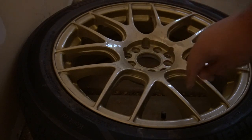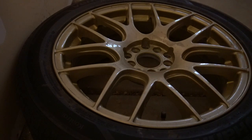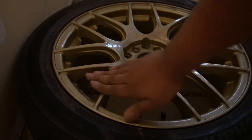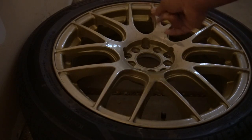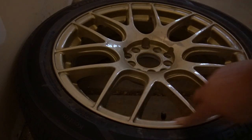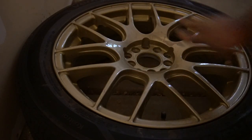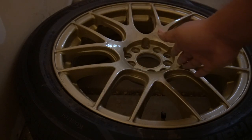One tip I do have for you guys is make sure you get into these little crevices right here, because those are hard to reach when you have a big piece of sandpaper. But luckily you can make it to the size you need and just try to get the best you can. Try to get all this clear coat off and the gold paint so we can go ahead and prime it. Of course, if you have any curb rash, you're going to need some lower grit sandpaper to go ahead and sand it smooth so it doesn't show on the final product.